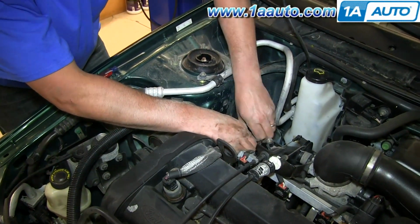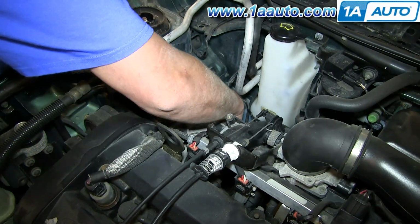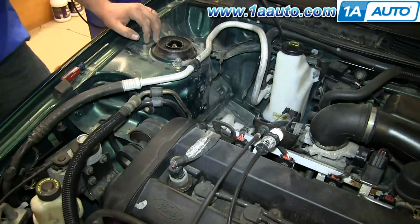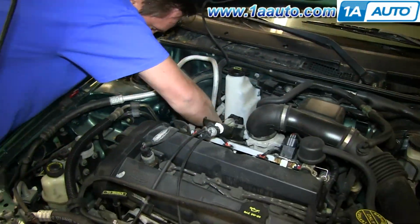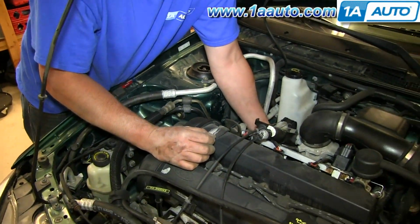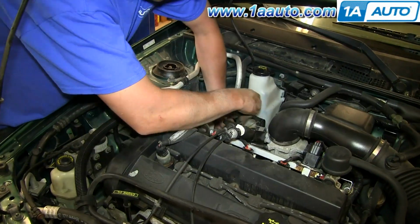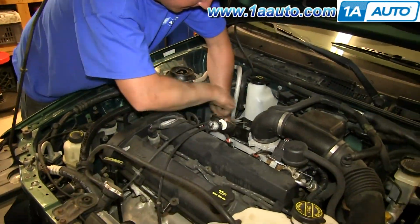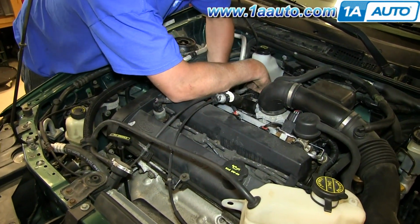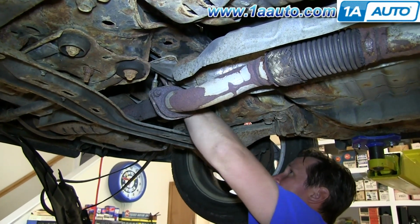And as you saw there, I'm going to start speeding up here a little bit, but it just takes a little bit of positioning and get the alternator down into place. Start the top bolt in. Be careful to look down, use a flashlight, look down, make sure you don't pinch any wires or any other components in between the alternator and the engine or the bolts. And you can actually start all 3 bolts by hand from the top, tighten up the 2 bolts that are fairly easy to get to, and then you can transition down to the bottom and just tighten up the bottom bolt.